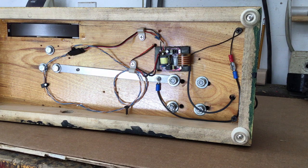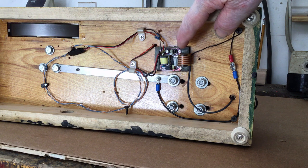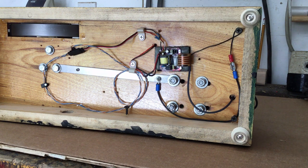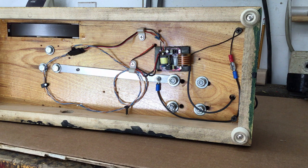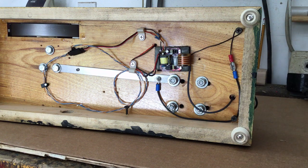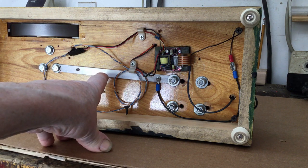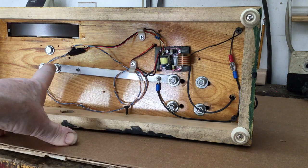This is the underneath side of the engine. This little circuit board here is the capacitive discharge ignition circuit — it basically takes the three volts or so from the battery power supply and generates a high voltage to fire the spark plug. This is the high tension lead right here, this little black wire that goes to the spark plug. This big silver piece of aluminum here is simply a grounding bus bar.